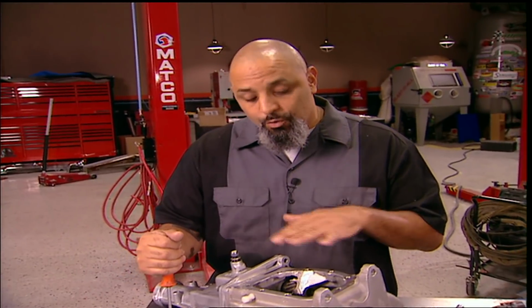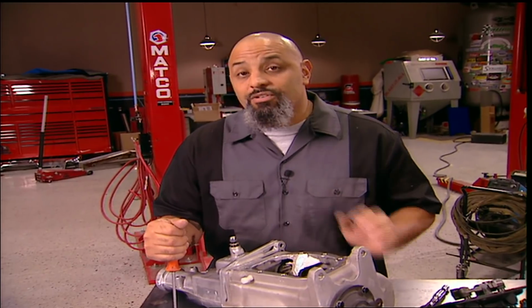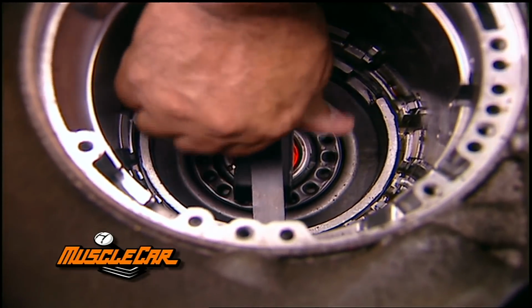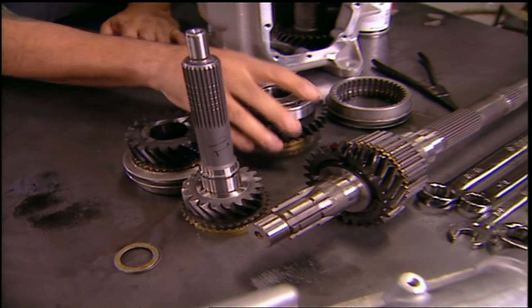Modifications are limited to swapping out gears. Rebuilds typically mean replacing worn-out synchros. You might think it's easier to work on than an automatic because there's less parts. Not really. A blown-apart automatic takes some concentration to reassemble, and you need some special tools to release some snap rings. The manual has some minor challenges as well.